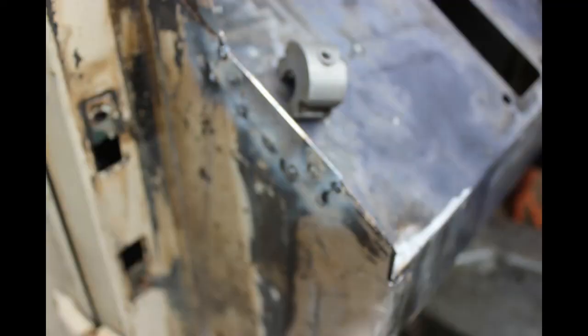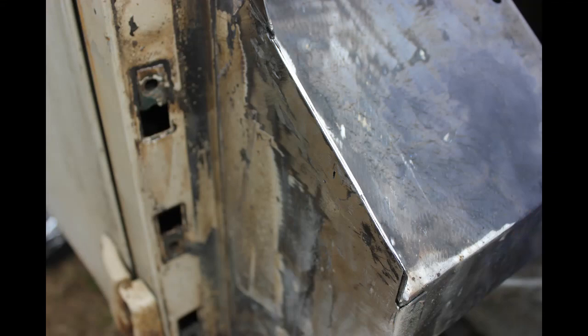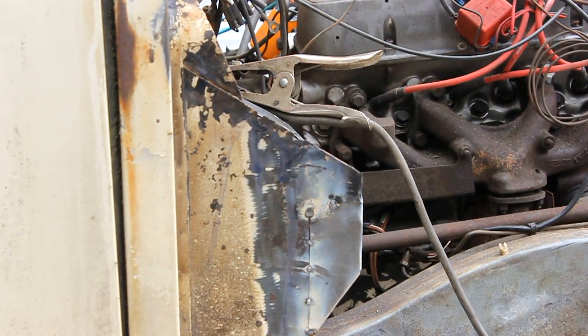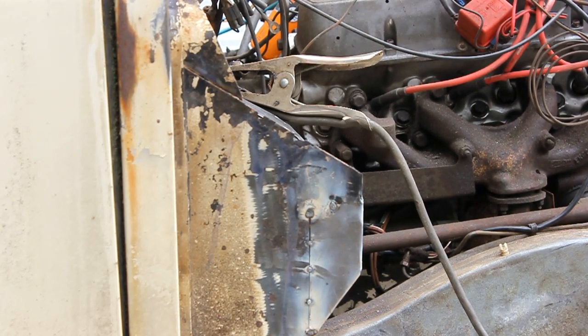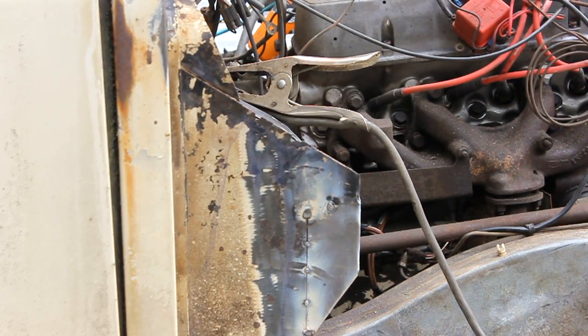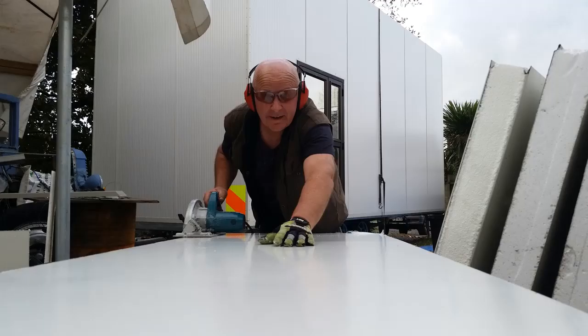Here's that little magnet I like to use to hold pieces in place while I tack them. And here's the finished job — that lip that sticks up was all crumbled away and dissolved, so I've cut the damaged piece out, made a doubled-up new section, tacked it in using the magnet to hold it in place, and then done a full seam weld on both sides. By the time that's painted, nobody will know I was even in there. I do hope you enjoy these money-saving, do-it-yourself vehicle fixing, off-grid lifestyle tips and tricks — it's something I really enjoy sharing. Make sure you subscribe and I'll catch you in the next video.